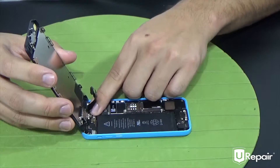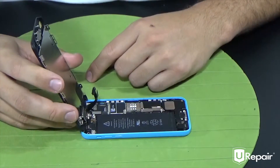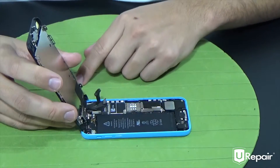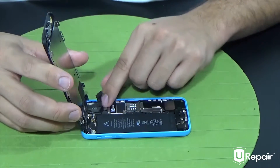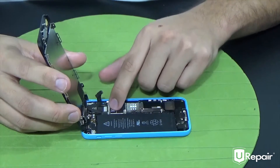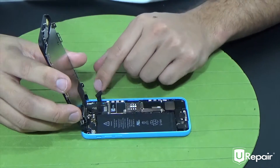Make sure that you don't pull up as it will come loose. The next step is to connect the LCD cable. After you connect the first one, the second one will pretty much be aligned. Do the same thing — feel for the socket, feel for when the flex drops in position, and then gently press down on it. You don't want to be pressing repeatedly, as you could damage the flex and the socket. When you feel that it's properly plugged in, you move on to the next one.